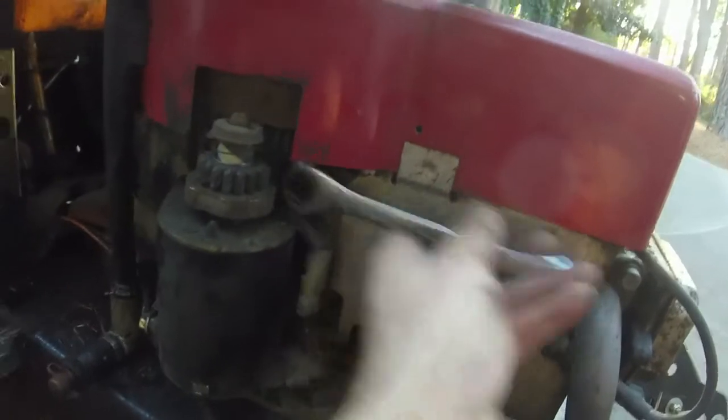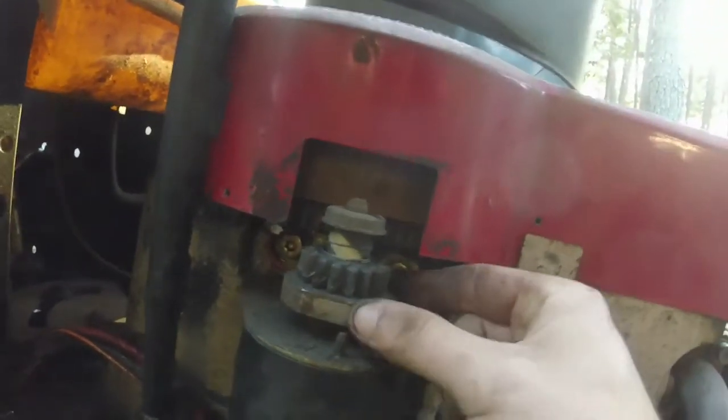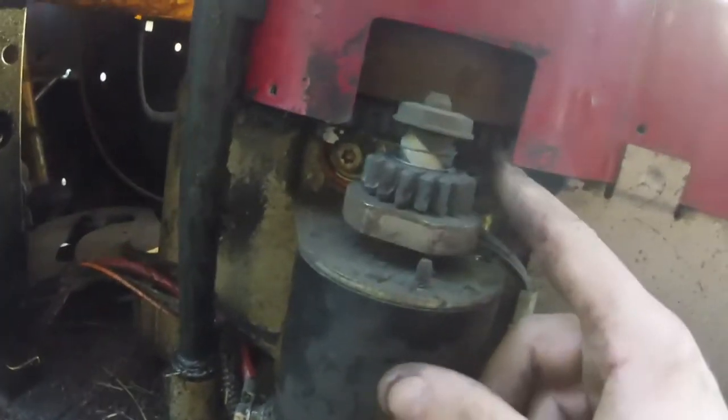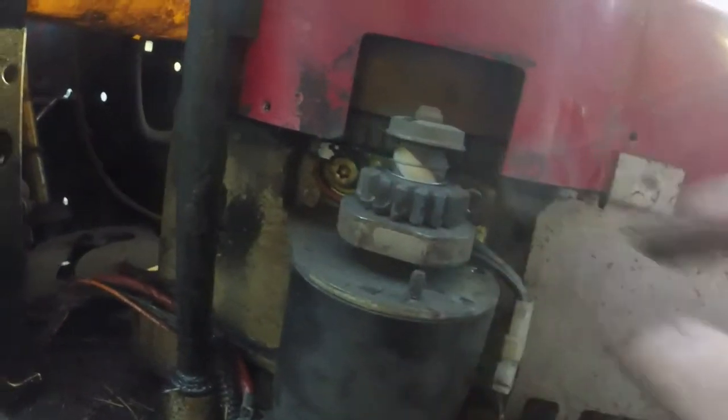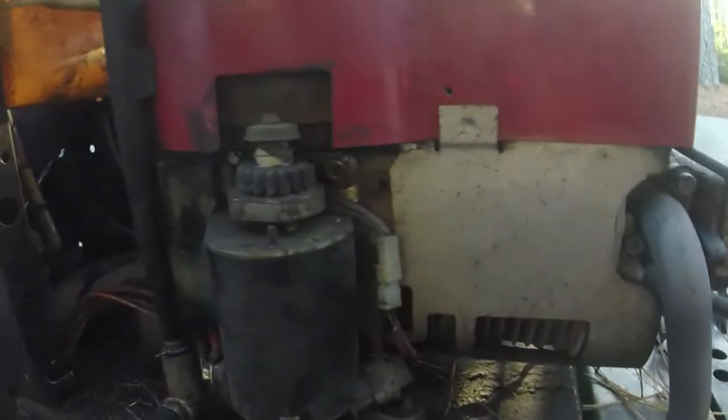Sorry about the sun glare. There's your nut — a half-inch ratchet wrench works best here since you have the access on a single cylinder. If you have the v-twin it's really hard to get to — you need a wobble extension. One thing I noticed is that this is very close to the actual flywheel, so make sure you have a plastic flywheel gear matched with a plastic starter gear. If one of them is metal you're going to eat out either the flywheel gear or the starter gear. And that's how the wire goes around the little clip for your stator.